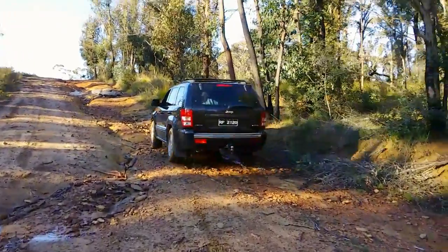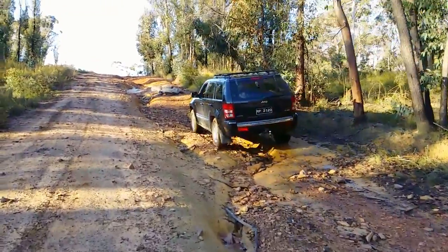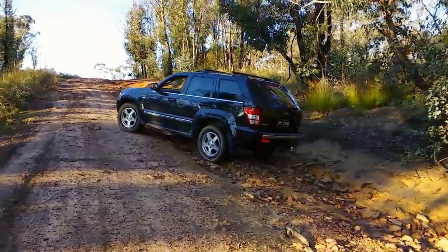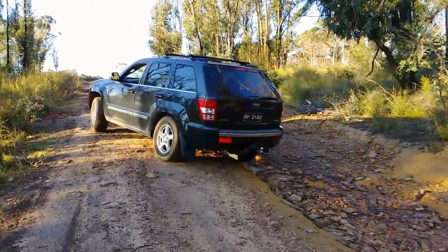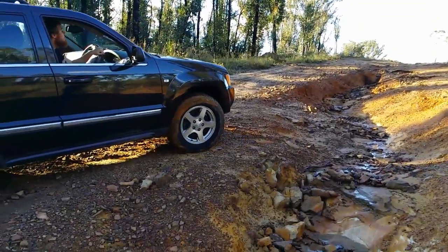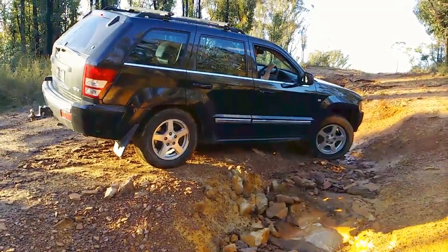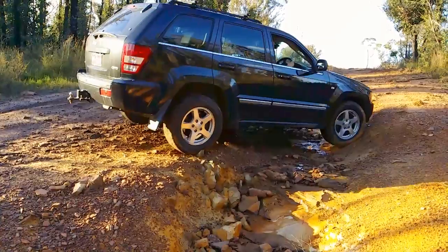The motor is also mated with a Mercedes automatic transmission, which Chrysler calls NAG 1. NAG 1 stands for New Automatic Gearbox Generation 1, or the way Mercedes refers to it, it's a W5A580 transmission. Sometimes that first 5 is omitted. Right hand down, yep. Not too much. Straighten up. Yep, that's it. W stands for transmission using a hydraulic torque converter.